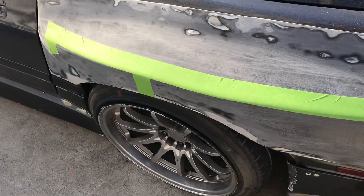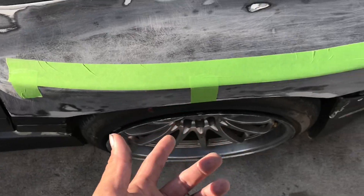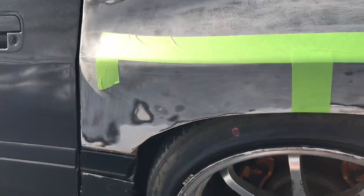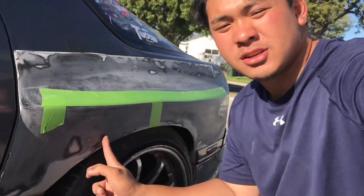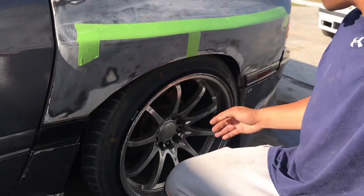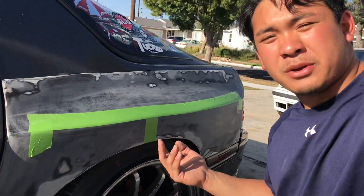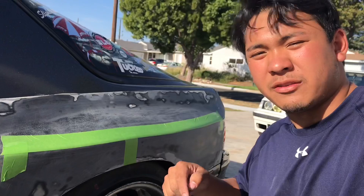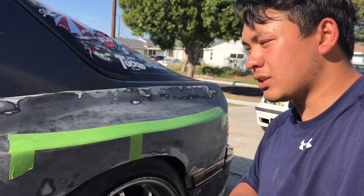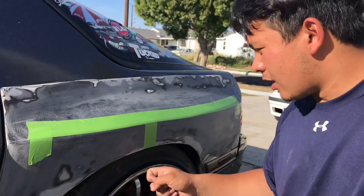You might be like, hey, how the hell did you fit those wheels if you can barely fit these? Well, I don't know if I showed you guys in the previous videos, but I actually bulged out these rear fenders, and that's how I was able to fit it. When you bulge it out, you push the bottom sides in, this comes out, and you're able to fit a bigger wheel. If I didn't post a video on it, I'll put a link in the description to Offbeat Garage's video — he went into depth explaining how to bulge your fenders to fit wider wheels.